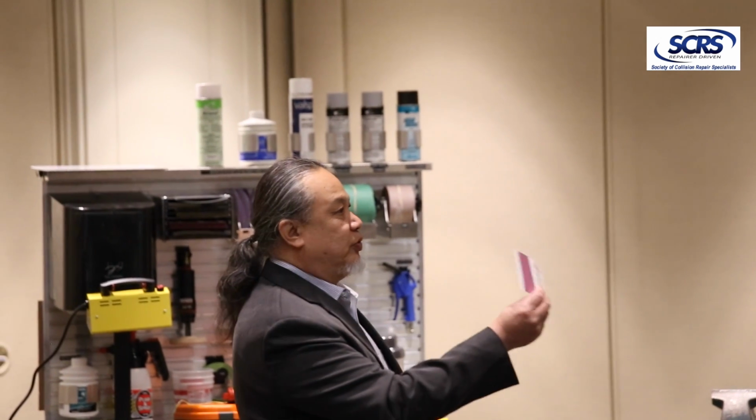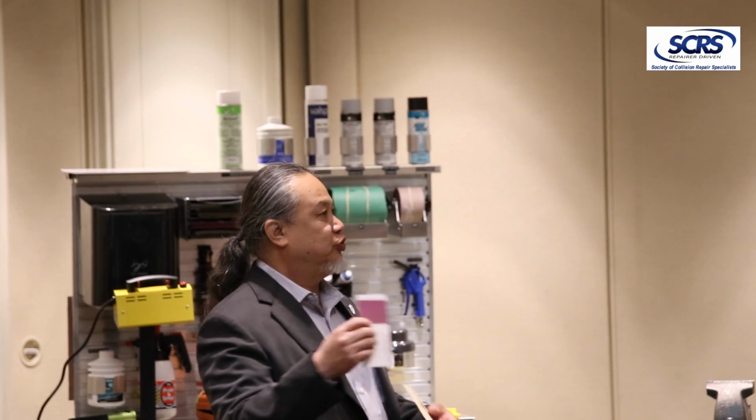Infratech came out with a very similar type of card. Metamerism is basically that your eye has 3 color receptors, and it defines certain wavelengths in color. The perfect color match comes about when these wavelengths intersect. If you look real close, in certain lighting you can see a difference in the color, when it's not true sunlight, 5,000 degrees. So what this card allows you to do, during your color matching of vehicles, is walk outside, hold it out, and see what the perfect time of day is to color match.